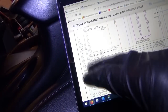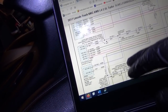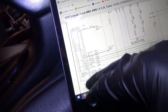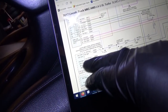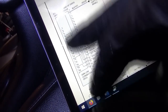If you use a breakout box, you could only talk to high speed CAN 1 and this green orange, which is high speed CAN 2, it looks like. That's on pins 3 and 11, and high speed CAN 1 is on 6 and 14. But I want to see all three networks, including high speed CAN 3 and medium speed. These come to the gateway module, but they don't go to any of the pins on the DLC. So basically we're back probing here, four channels.